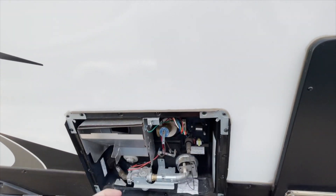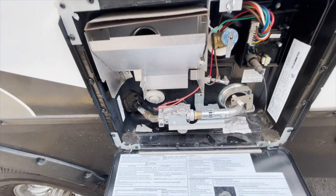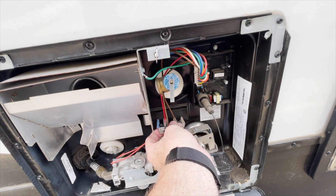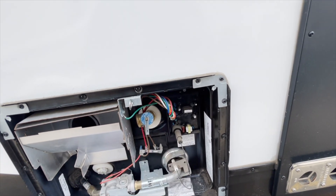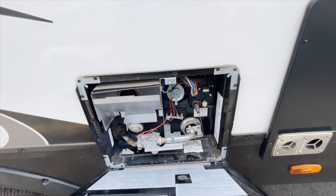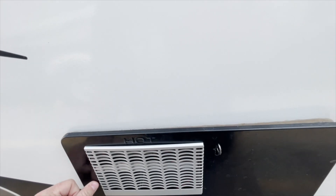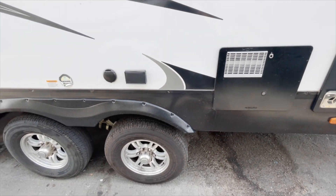Let's see if I can get this guy open one-handed. Looking at the water heater, this is definitely the original drain plug, so that needs to be serviced. I look at stuff like the thermal cutoff, ECO stat, and wiring harnesses. I'm going to go back and give it a more thorough inspection, but this is just to give you guys some heads up. I talked to the owner to find out if the water heater has ever been serviced. Doesn't look like it to me, but we'll double check with them.